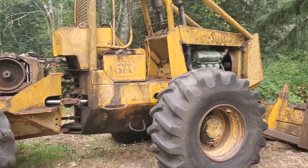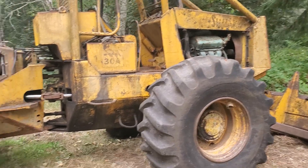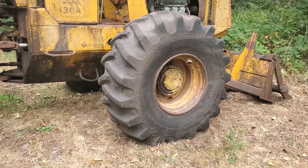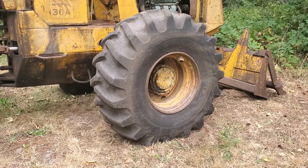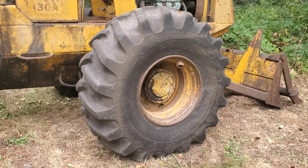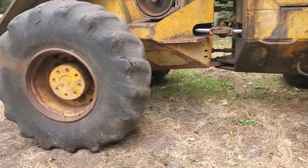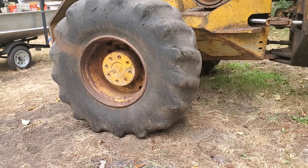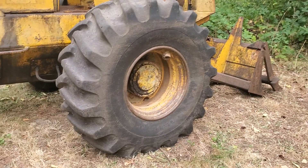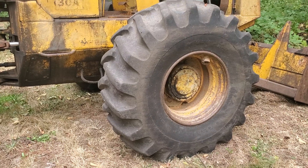Here you go — Model 30. Garrett has a 30 rear end and it's been changed out to a 30 but with slightly different planetary covers on the front end, but it's a 30 front end as well. Factory they came with a Garrett 22 front axle and a Model 30 rear axle, but they were still the same width and same size — they just had smaller axle shafts and they would break.